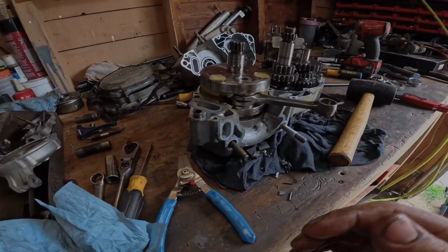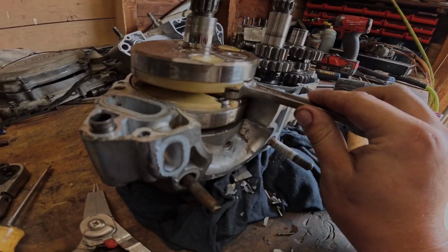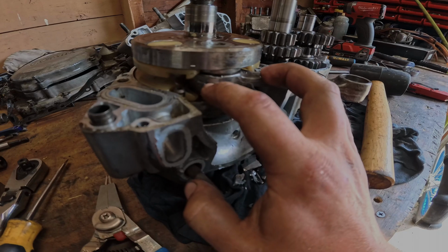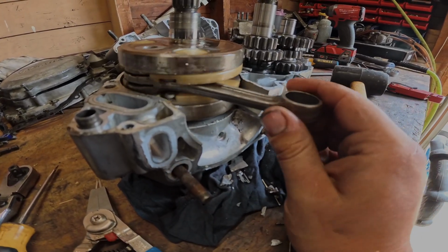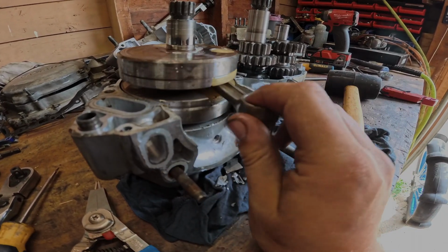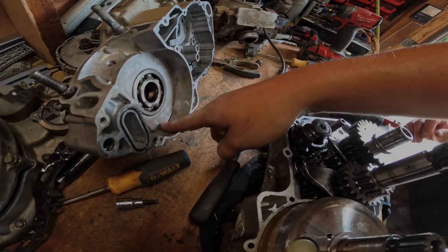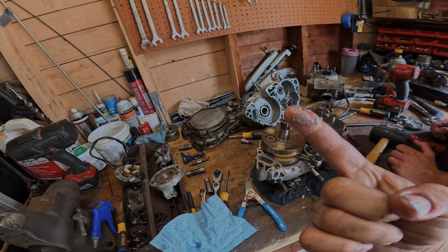Here, look at this. Oh, I can't see you guys. Hold on. All right, so there's a piece of piston wedged into the rod right here, and it won't come out. That might be part of the play. Well, that might be why it potentially stopped too and couldn't rotate over. It felt like it was kind of hitting down here. Now that we're thinking about that, we should inspect this side and make sure there's no punctures or cracks. You can see there's pieces of piston everywhere.